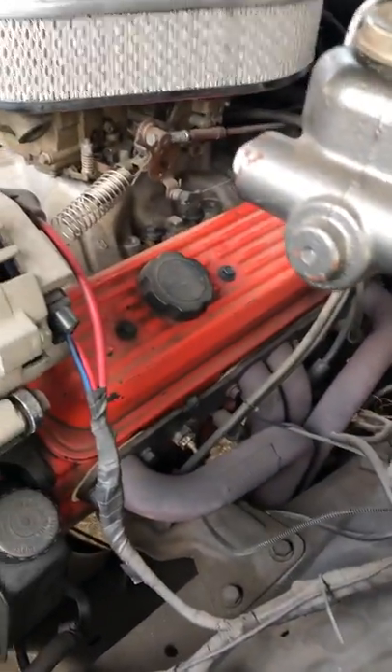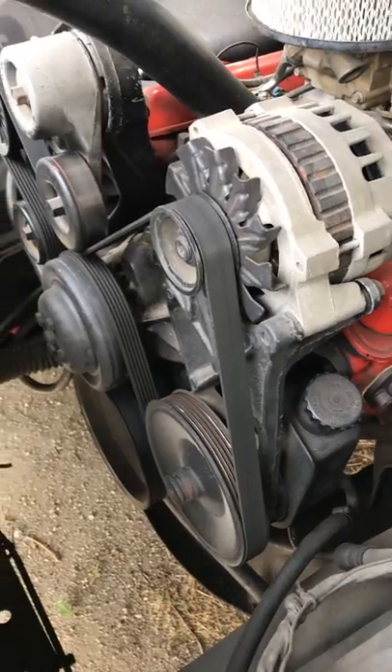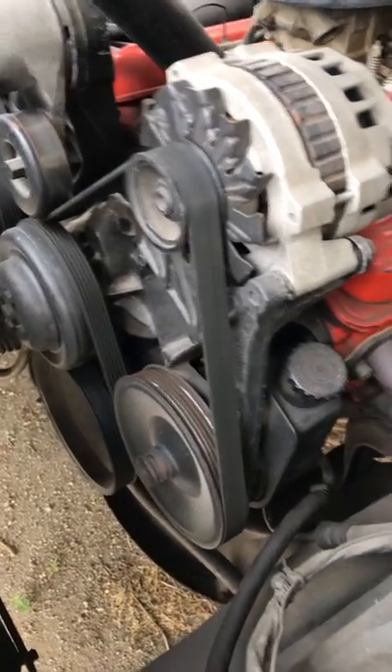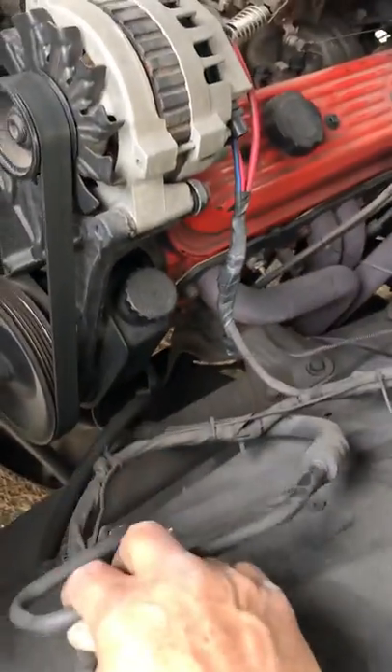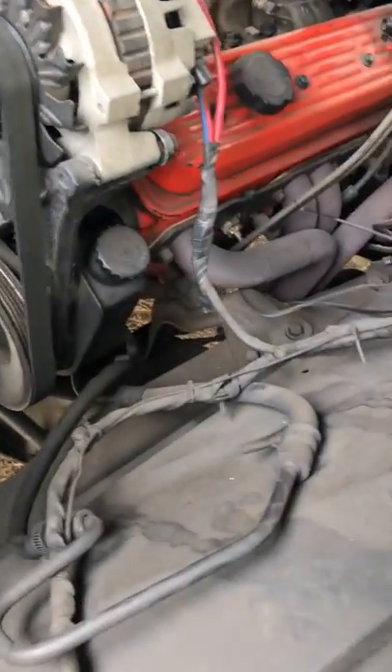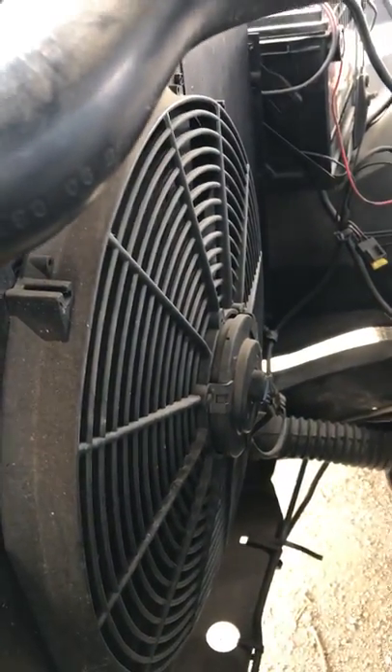It has a 90s 5.7 motor, which is cool. The nice thing about those is they come with a serpentine setup. I did think it had power steering when I saw the ad but it doesn't — the pump is just sitting there not connected, but that's fine, no big deal. It does have an electric fan setup — they have it wired straight but we can take care of that, it's not a big deal. The wiring looks pretty good, doesn't look horrible.